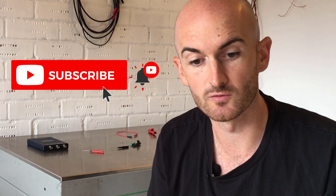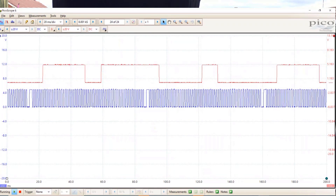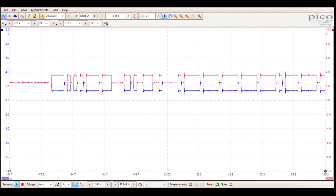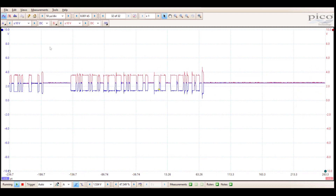Before we get to the downsides, let's have a look at some examples of where I've used this cable for automotive diagnostics — all from videos I've done in the past, so go check out the channel and subscribe. This signal is from a camshaft/crankshaft correlation test we did on a BMW N47 engine, which is quite common for timing issues. We've got the camshaft and the crankshaft signal there — really quite nice signals. Here's a CAN bus signal with channel A and B connected to CAN high and low; this is the high speed CAN at 500k and the signal is really quite good.